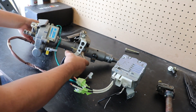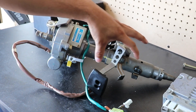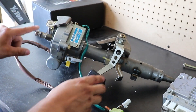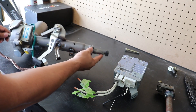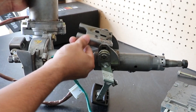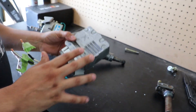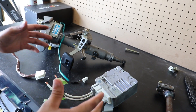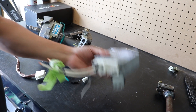This system consists of the actual steering column, which is what we're going to be replacing with, and we're going to have to do some pretty significant modifications to make this fit, just because this shaft does not fit the factory DSM. Another thing is the mounting does not fit as well. It also comes with its own ECU. There are a lot of electrical power steering systems out there, but the reason why a lot of people use the Toyota Prius system is because it's super easy and not complicated.